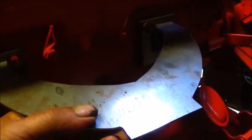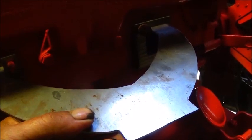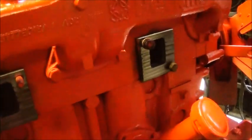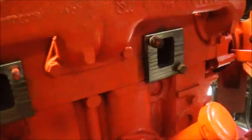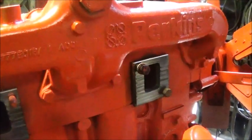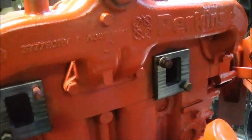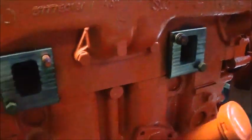make all the pieces we need to make. We'll probably clamp it down to the welding table to keep it square, and when we're done we can still surface grind it and get it back exactly straight, because I'm sure it may warp a little bit, and we want it to bolt good and tight on there and be level. This is, like I said, 1/8 inch, so once it's all welded together good, it should be plenty strong enough.